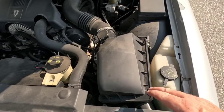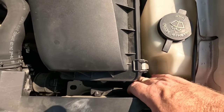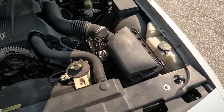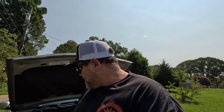What we're going to do is remove the air box assembly. There is a silencer that goes from the air box to behind the headlight — we're going to remove that, open it up more so that it can actually breathe. We're going to quantify our results with this little thing right here known as a Draggy. I'm going to do the air box and see what that muffler delete is worth as well.